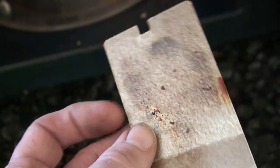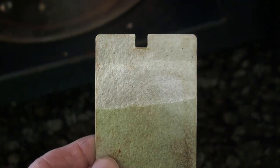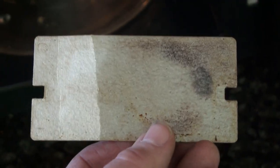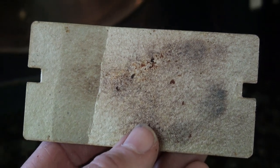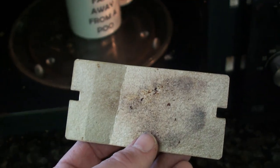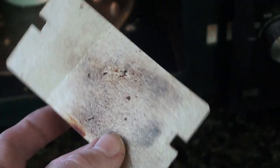Mica is a mineral that was widely used as an insulator back in the old days, and still is. I took this off and the whole thing just burst into life. So it isn't the magnetron, it isn't the microwave — it's just this cover that has food contamination on it. In microwave terms it's reflecting or absorbing the power. I don't think it can be absorbing it, otherwise it would get red hot.